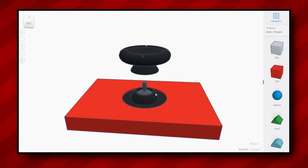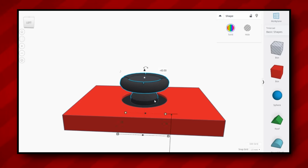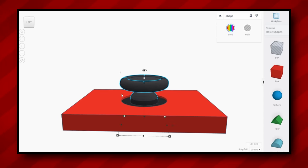Now, what I have found is that Joy-Con drift is not necessarily caused by any mechanical failure, but rather by dirt, dust, and grime affecting the sensors within the mechanism. So to fix this problem, we're going to want to try to get between these two layers of plastic in order to clean out the internal parts. And what we're going to use to do that is our old friend isopropyl alcohol, the game collector's silver bullet.